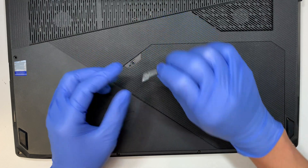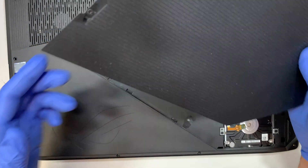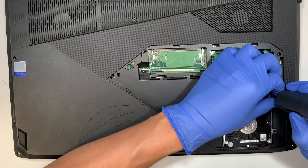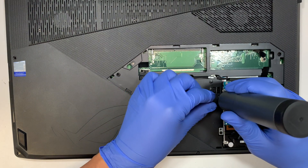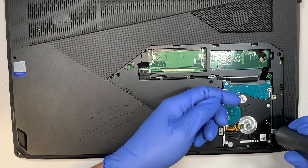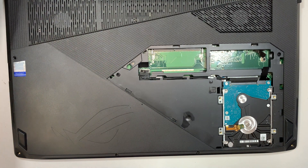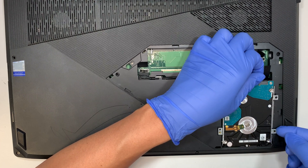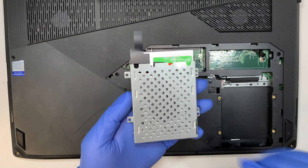Let's go ahead and get this rubber removed — you need to remove the back cover. Once you remove the back cover you can see the hard drive is installed. This is the regular hard drive. If you want to speed up your computer, this is the slot for installing an M.2, or you can upgrade to a solid state drive by cloning the regular hard drive. I have a separate video dedicated to cloning — the link is in the description below.